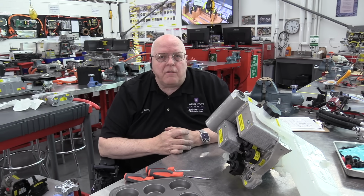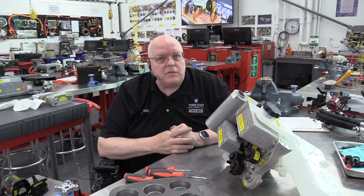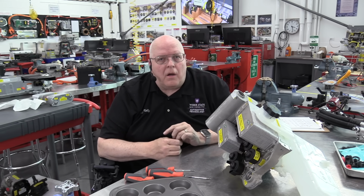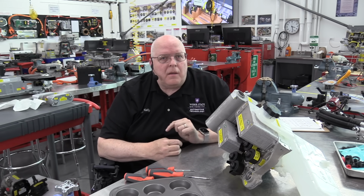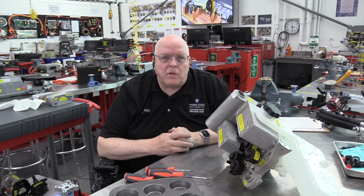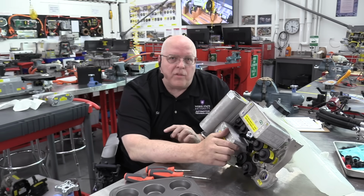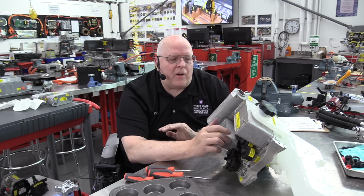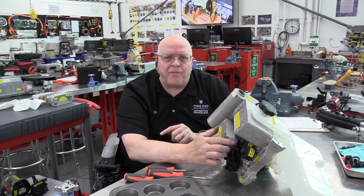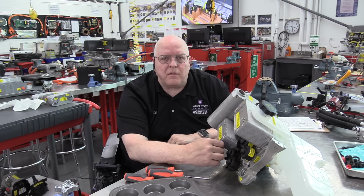So, if you're in the market for an electric vehicle, I would recommend you seriously consider one with a heat pump. All heat pumps are not the same. Do your homework, do some research, find out customer reviews. Tesla has had some problems with this heat pump when it first came out, with no heat at all occurring, and they figured out that there was a solenoid that was not bleeding off pressure at a certain time when it should have been, and they've released a software update to fix that.